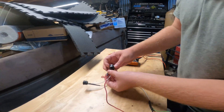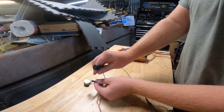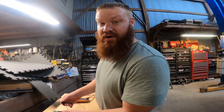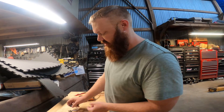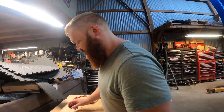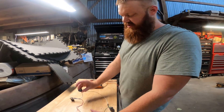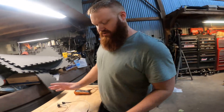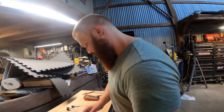But we ran some extra wires off that same connection so we can put a resistor in between. Our resistor is actually a potentiometer, so a variable resistor. And then we have a switch here. As the forum will indicate, when it gets really cold outside, this may not help your situation — it may make it worse, it may freeze your EVAP up. So when it's really hot like it is here now, we can flip it on and adjust the potentiometer to modify that setting. And when the temperature drops back to normal non-summer temperatures, you can use the toggle switch and click it off. And if you put it in your truck and want to sell it or decide you don't want to do it anymore, you just take the whole thing out and reconnect the original terminals. No harm, no foul.